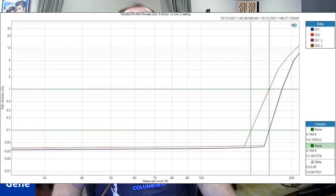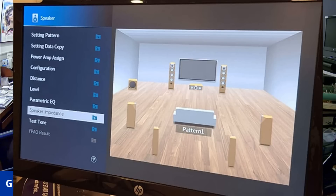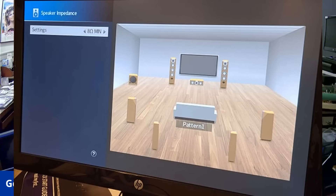Now, what happens when you set the impedance switch to the low setting? First, I want to show you where this is. I don't like the fact that Yamaha put this switch so easily found on the on-screen display. In the past it used to be in an advanced service menu the general public couldn't access. Now they're sticking it in the speaker setup where anybody could just go in and set it incorrectly. You go into the speaker configuration option, click speaker impedance, and it's defaulted at 8 ohms minimum — and this is the setting you want to keep it at.